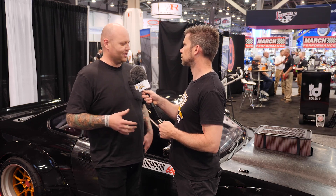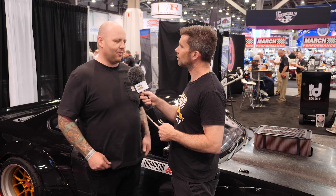We were talking about the power band that a Pro Charger delivers. A centrifugal supercharger is essentially a belt-driven turbo and you get a boost curve that increases with RPM relatively linearly, so a lot of the power happens at high RPM. How does that affect you for drifting? It wasn't ideal — you'd need nitrous for it, or up the compression and not spin the blower so hard to have a little bit of punch. I didn't spend enough time on it to perfect it. When it came on boost it was too much — too much wheel speed — and prior to that you were having to slip the clutch too much.